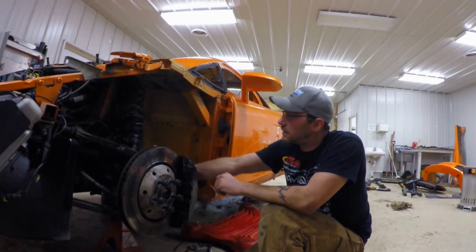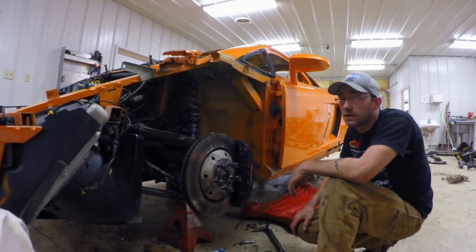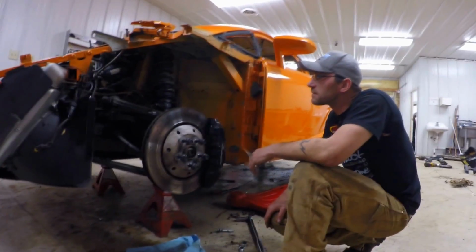That's really about it, unless we get into some serious travel. We'll see how much travel we can get with our ride suspension so we don't hit on the upper side, but we can modify that in the same fashion as the lower. Okay, what are we expecting to have up here as far as travel goes? Hoping for about the same as the rear, at least 7.5 inches. Okay. And that's simply with the Heim joints and notching.